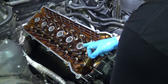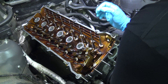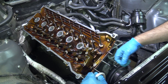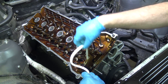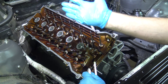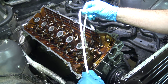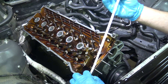There are three basic ways you can keep that from happening. Number one, you can hook up compressed air into the cylinder and that will keep the valves closed. Or you can use some nylon rope — feed it down into the cylinder, back the piston down a little to make room, then move the piston up so it scrunches the rope up against the valve, keeping it from falling. You can use nylon rope, rubber vacuum hose, or something similar — but I'm going to use rope.